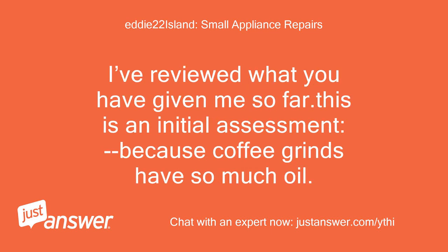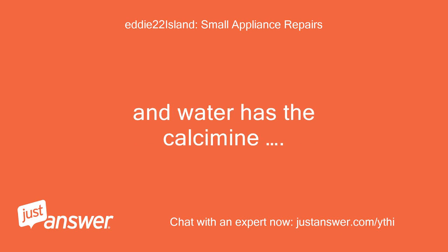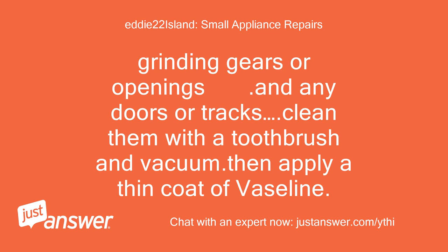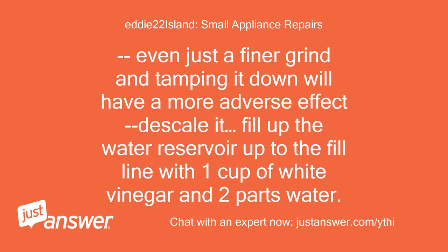I've reviewed what you have given me so far. This is an initial assessment, because coffee grinds have so much oil and water has the calcium. They have a tendency to clog these openings and tubes. Routine maintenance, cleaning, and decalcification is paramount. It would really help to use filtered water to clear the grounds. You really have to be diligent in your approach in clearing puncture needles and ports. Grinding gears or openings, and any doors or tracks, clean them with a toothbrush and vacuum. Then apply a thin coat of Vaseline. Even just a finer grind and tamping it down will have a more adverse effect.